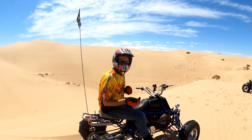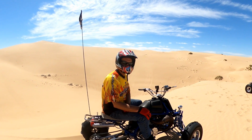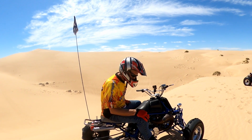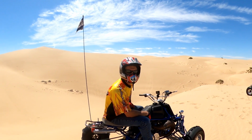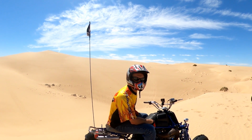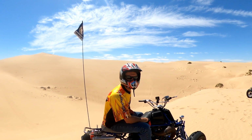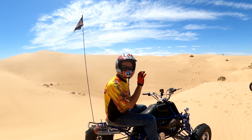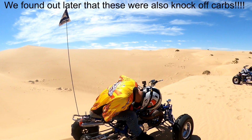If there's no load on it, it seems to run like a bat out of hell. And if you put a little load on it, it starts sputtering. When we were on our way over here, I think I was in second and I pinned it and it was good when you started speeding up. And then third, I pinned it, it was good. And then we slowed down and started going up a hill and I was still in third and I was holding it all wide open and it was just like, yeah, it's really strange. It's an intermittent problem.